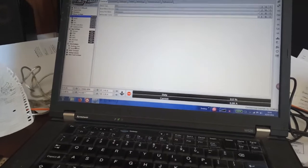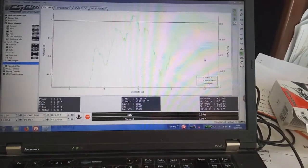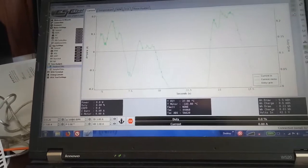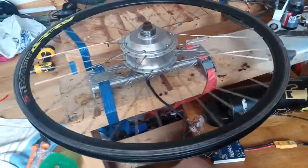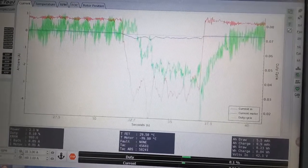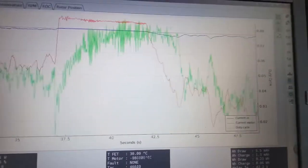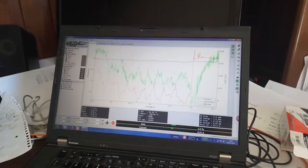I haven't checked this out yet. If we go to real-time data analysis and start that off - if I start turning the wheel, that's me doing it a wee bit. You can see that green line is showing us the duty cycle. So if I change the RPM down to, say, a thousand, that wheel is going around quite slowly just now. When I do assist it, the red line - the current - goes down. I'll let go now - that's it running smooth, all on its own power. And now I'll assist it with my finger, and the current is powering into the battery. You can see I'm regenning into the battery there.